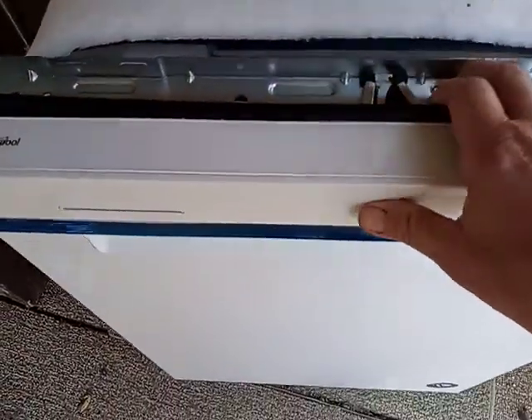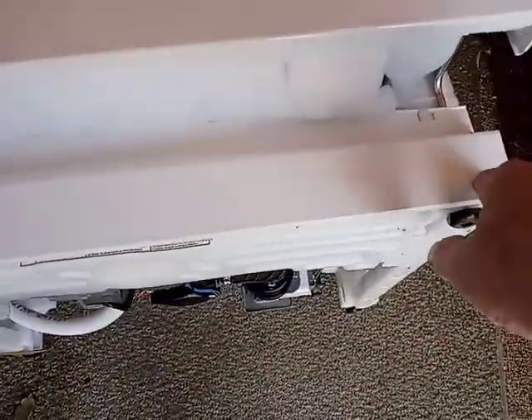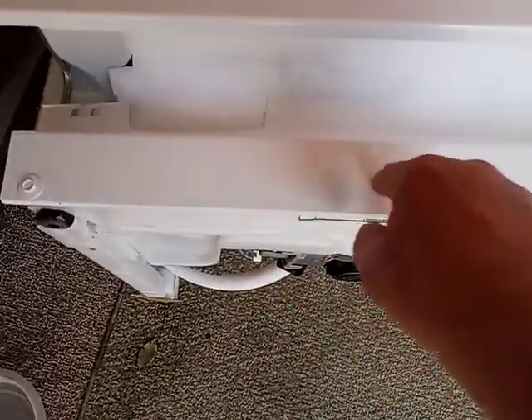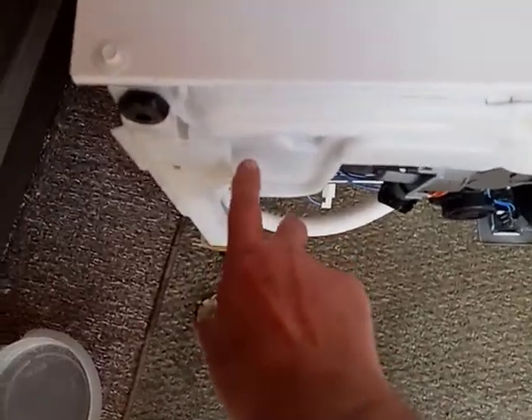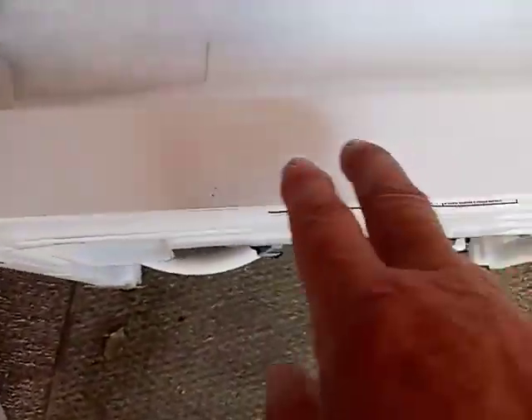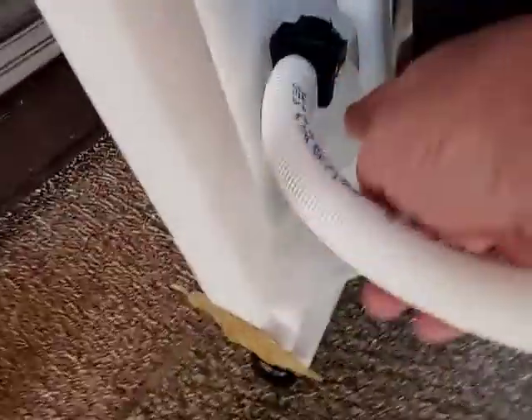When I install these dishwashers, I tilt them back like so, remove these screws here, and that allows you to access the electrical box right here. Your water supply line is right here and it connects with this connector — it's a 90-degree fitting with the hose end on one side and a 3/8-inch connection on the other.